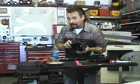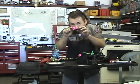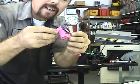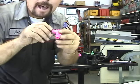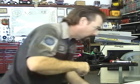Now I'm going to make it a quick video, so you're going to have to stay with me real close. But the idea is to get this little guy out right here. I'll get a close-up of that so you can see it. This is the little culprit right here. He's made out of plastic. They always break where the spring is held onto, and that keeps you from putting it into drive and gives you a bad day. So we're going to pull it apart real fast and try to make this a quick video. Let's go.